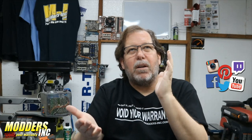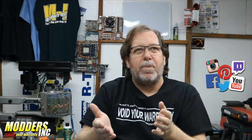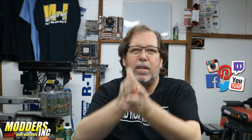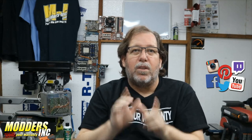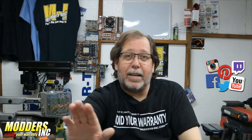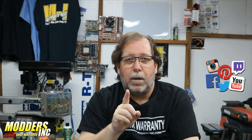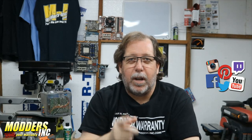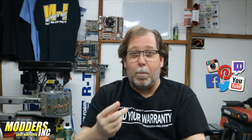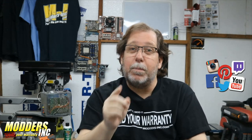So we kind of answered a couple of questions here. Just think of it this way: less is more. Okay? So think about this. Throughout my whole testing, I used one tube of thermal paste. So if you're putting yours on and you use a tube of thermal paste, or maybe half a tube or even a quarter of a tube, you've got too much on.